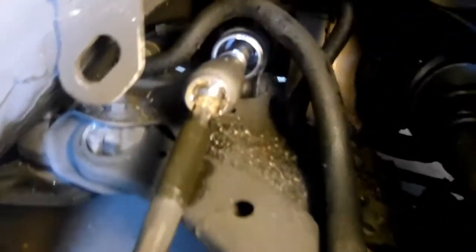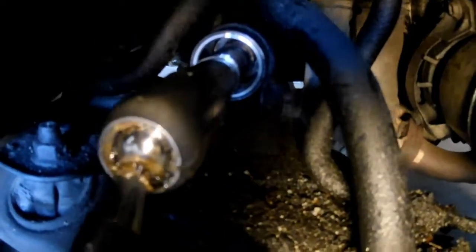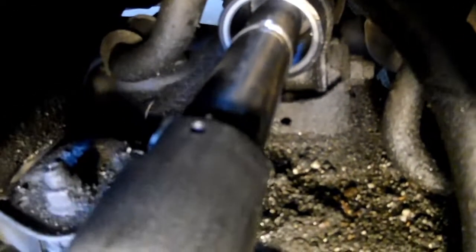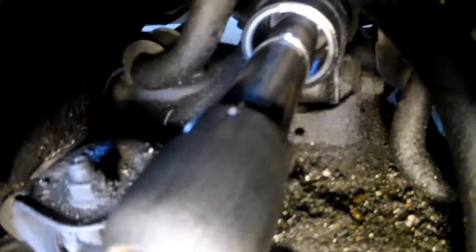That's how you remove the top strut. Now on the inner tie rod end, once you remove the boot - you have a rubber boot here - moving the boot allows you to get to this knuckle right here. This knuckle has two slide grooves in it. You can look at this one and say it's shot - it's just dangling around. She's also going to need a lower control arm because that thing is starting to crack as well. But today we're doing the inner tie rod end, outer tie rod end, and the strut on this one side, because the tire is leaning in that way.